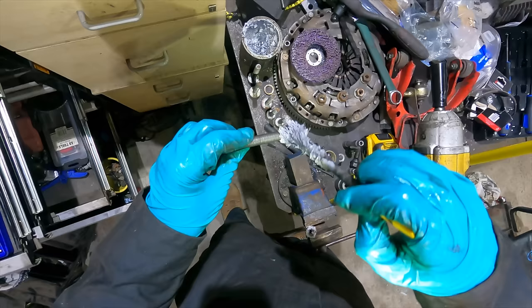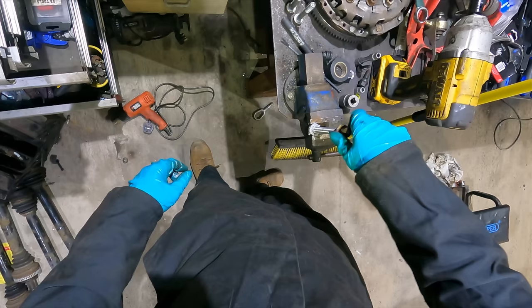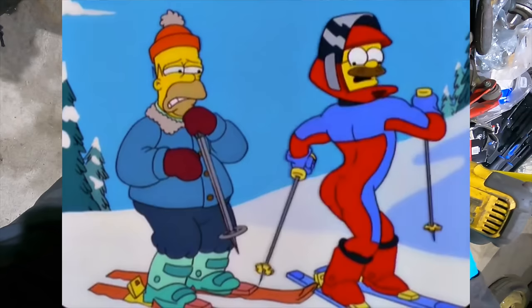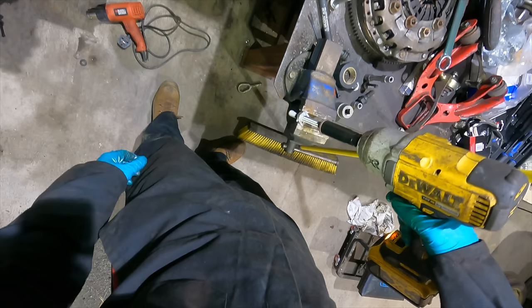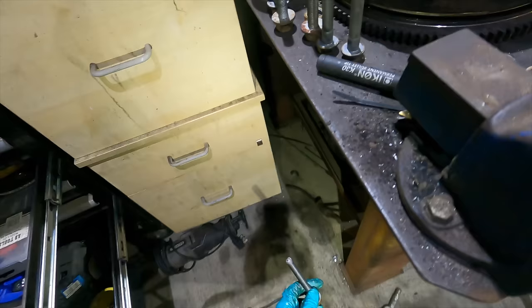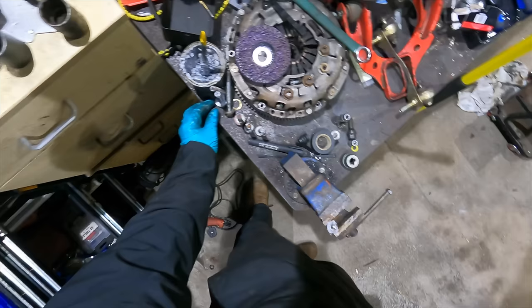Like I said before, I'm not after making the cleanest, eat your dinner off the underside of my car build with titanium shiny bolts or anything like that. The main focus of all this work is to have a solid rear end, with spherical bushes instead of rubber or poly. We're getting rid of all the poly bushes and going spherical or solid mounted. That's the goal here. Obviously, I'm making things look a bit nicer at the same time, but that's mostly just to preventively keep the car from rotting away. We're not doing a completely show and shine build, but some things will be nice.